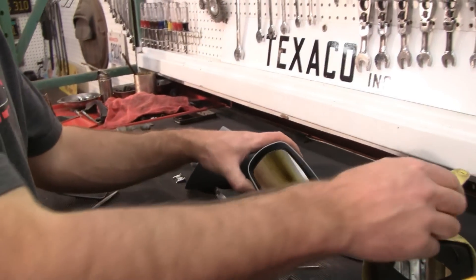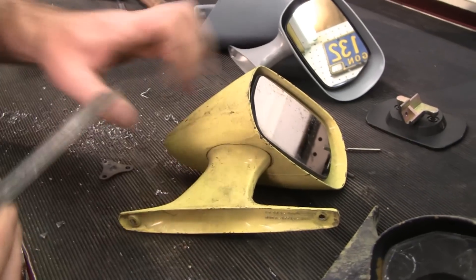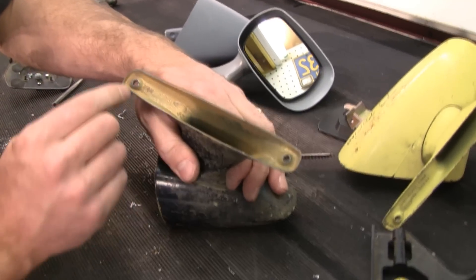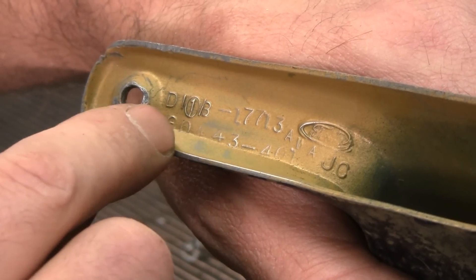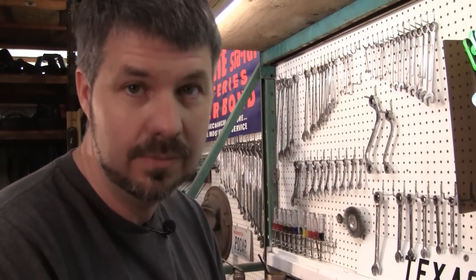There are two different types. The '70 has a D0 OB casting number — that's not a part number, that's a casting number for the base alone. The heads are the same: Mustang, even some of the Granadas I think, are the same. The difference is you'd see that the '70 has got an eighth of an inch difference or less than the '71 through '73. Here is a '71 through '73 — same basic casting number, except they punched a 0 around a 1, so it reads D1 OB. You're never going to know the difference. If you find a used '71 to put on your '70, they're all the same — Torino, Cyclone, Ranchero, Cobra, and '70 Eliminator is the D0, and the '71 through '73 Cougar is the D1.